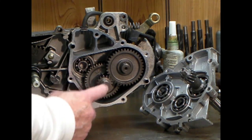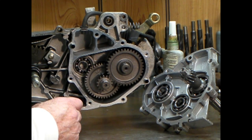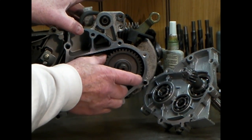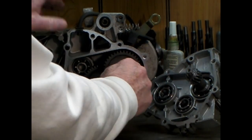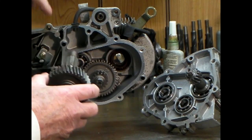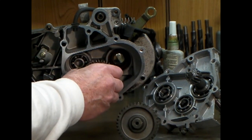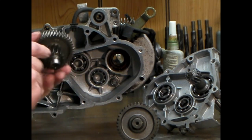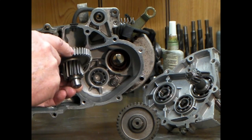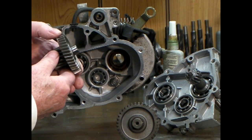So to get a little more speed I ordered some gears from Scrappy Dog Scooters, and they were pretty easy to install. This is your gearbox here. This gear right here is the one that is replaced, along with this pinion gear here. In order to replace the pinion you've got to take this gear off the old pinion and put it on a new one.